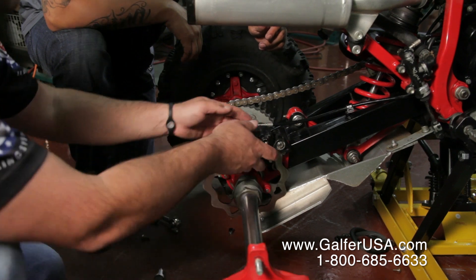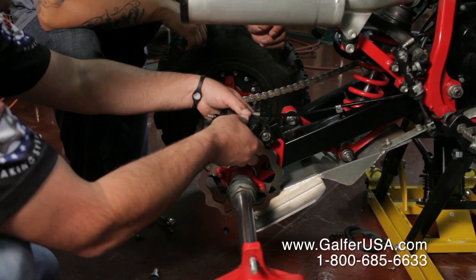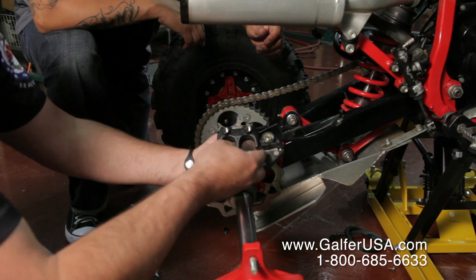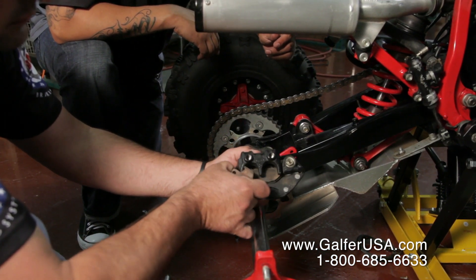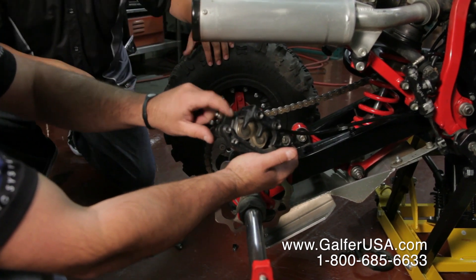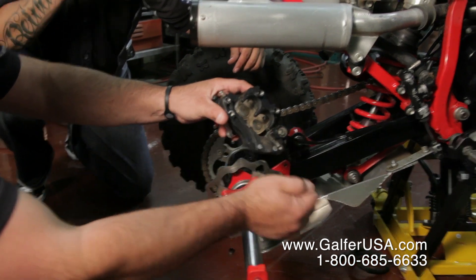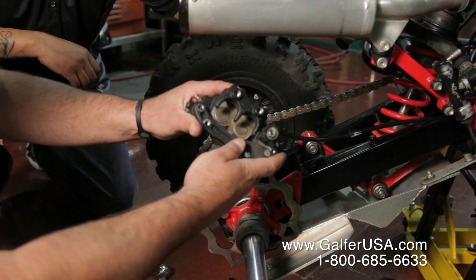Taking the pins out, the rubber has loosened up the caliper, so we just remove the caliper slowly and take the brake pads out. Now, same thing goes here — if your pistons are very dirty, you want to get a little bit of a toothbrush and some brake cleaner and simply clean around them.